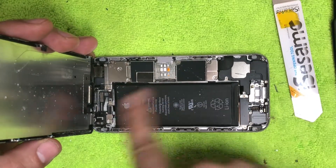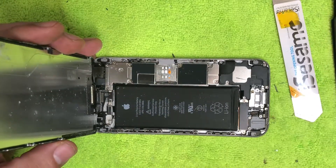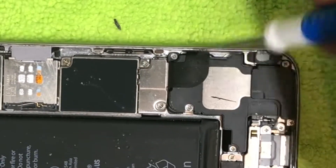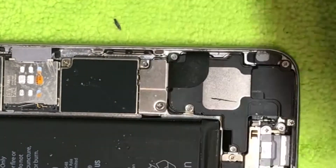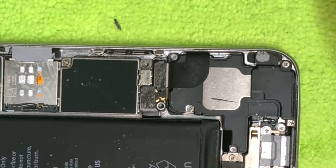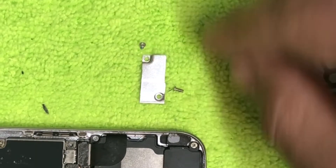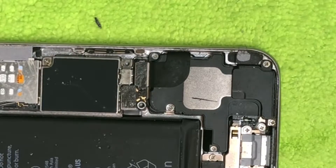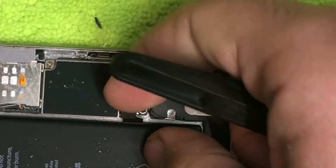As you can tell, this one has some glass on the inside — it's pretty dirty. The battery is more than likely dead, so we'll have to charge it when we fix it. The first thing you're going to do is take these two screws off. What makes it easier for me: I know that screw goes in that hole and that screw goes in that hole, so I lay them to the side exactly that way. You don't want to be putting wrong screws in wrong holes.